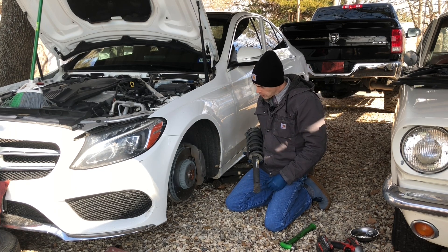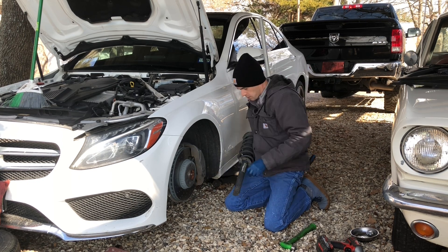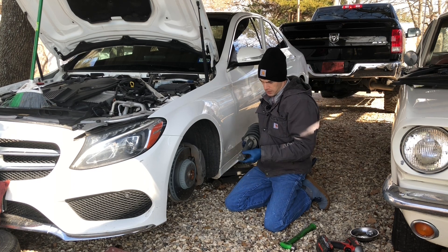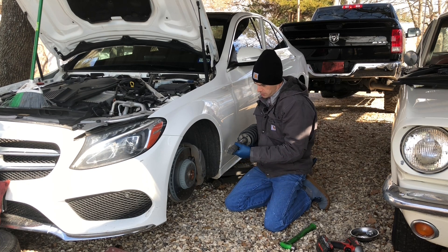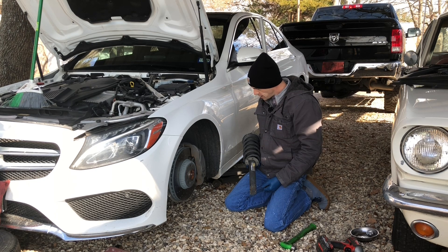It fell out because over the past month or so we've been hearing a creaking noise in the front suspension, and I didn't think too much of it — I thought whatever it is, we'll keep getting worse and creak more until it's obvious. Then I took the time, when we were on break, to inspect closer. The front struts felt pretty weak — I was bouncing it and could hear the creak pretty prominently — so I thought it needs front struts. So I did the brakes and then took it out for a test drive.